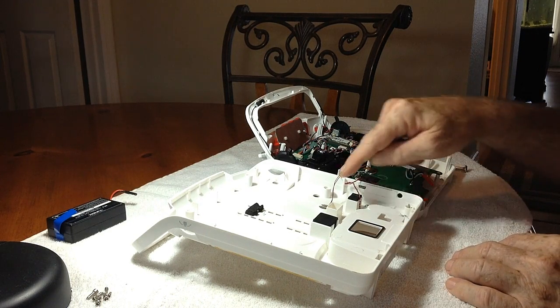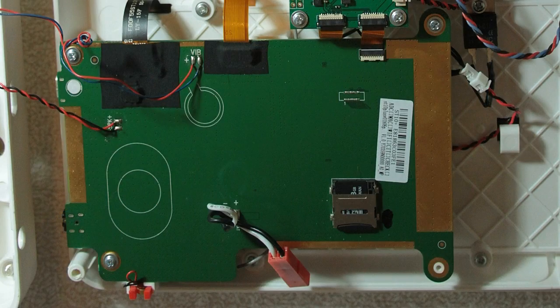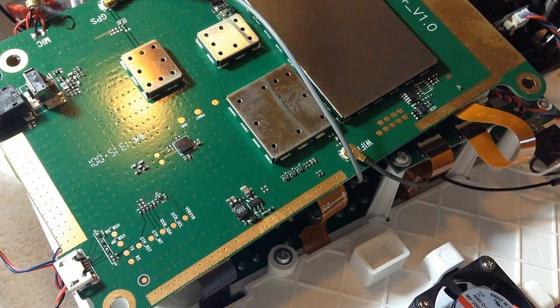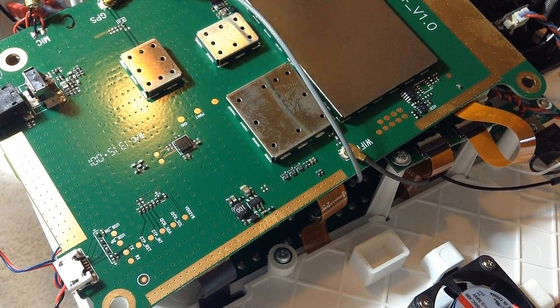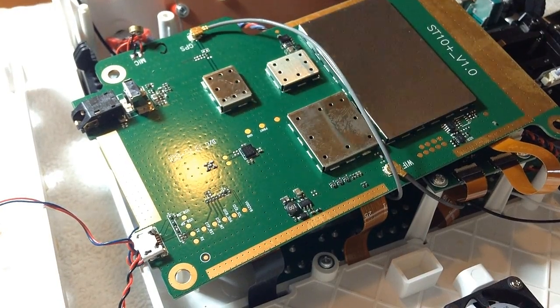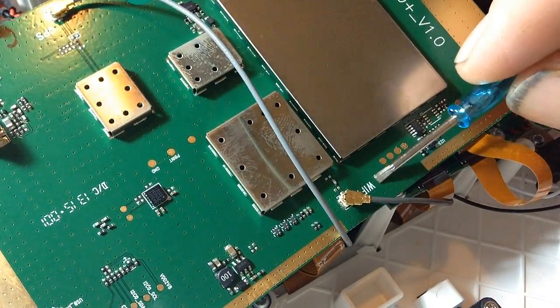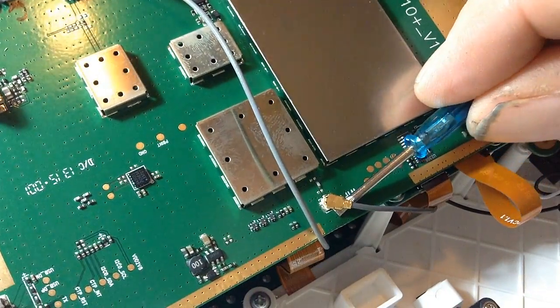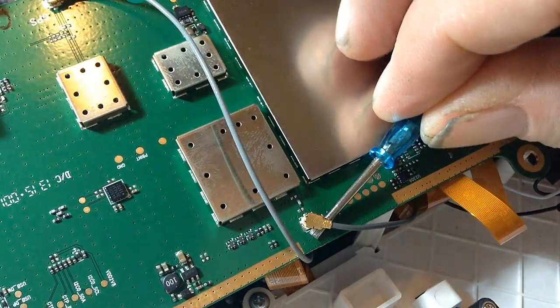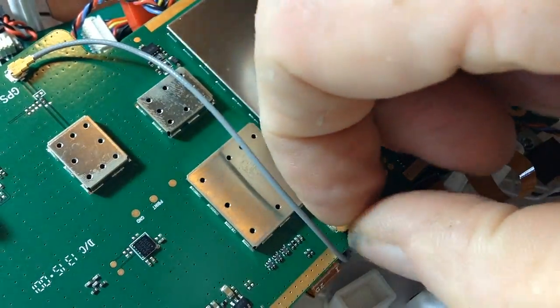Just take a little bit of time and look things over to get familiar with what you're looking at. Here's a photo of the Wi-Fi board — it's got three screws by default that you're going to need to take out; those are Phillips head. I've taken the three Phillips heads out and flipped the Wi-Fi board over. You'll see at the bottom a Wi-Fi connection — a little pigtail connection labeled Wi-Fi in the center. We're going to pry that off. It comes off fairly easy with just a little bit of tension with a screwdriver and then a pinch of the fingers.